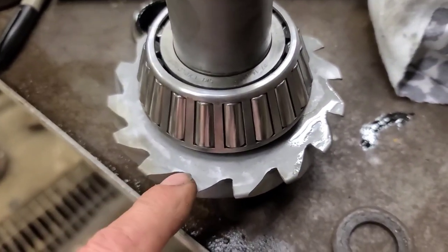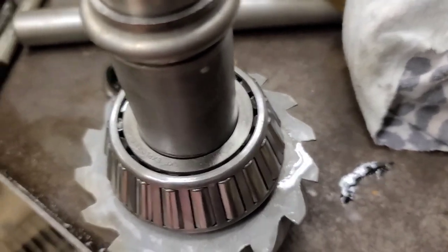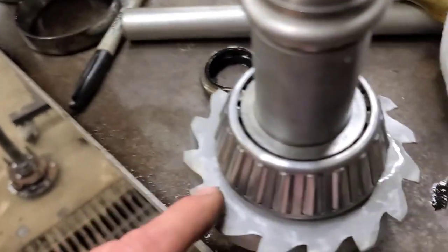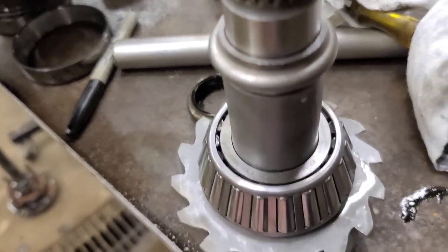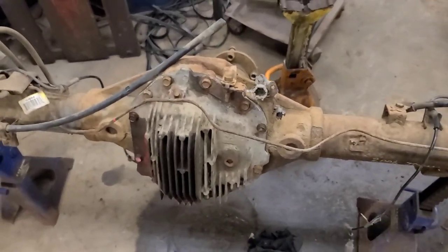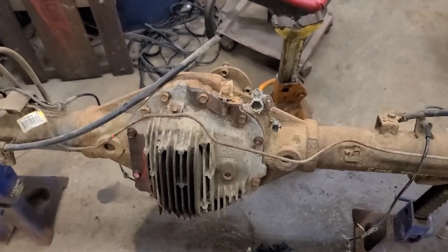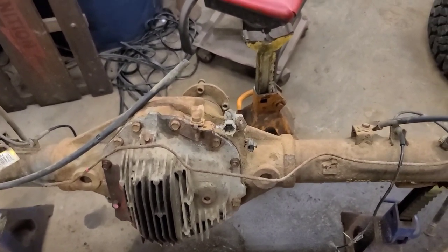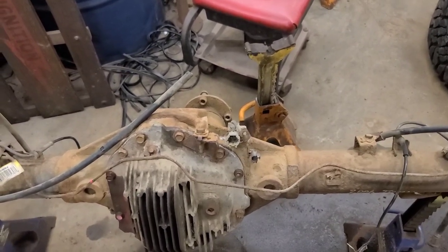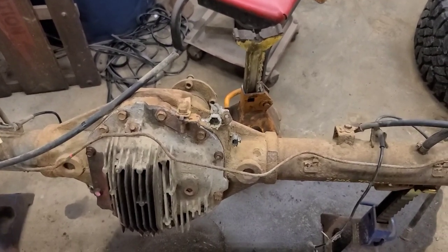So this gear set is wrong — it's a 4714. No, this is 4714, this is 4716, because that's what I thought I had. This pinion would match that crown gear. Talking with the salvage yard — because I thought this gear ratio was wrong — it turns out this is correct now. What I'm going to do is disassemble this used differential and salvage the crown and pinion and potentially the pinion flange out of it so that we can put this rear end back together. But that'll be tomorrow — I've had enough for one day. I think I need a drink.